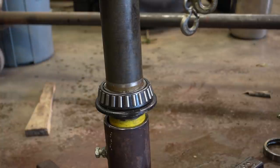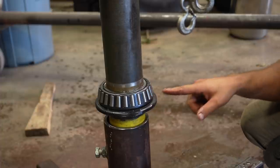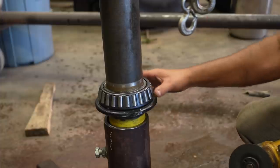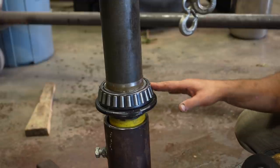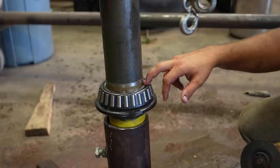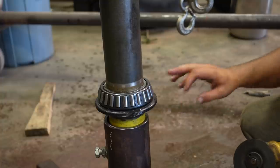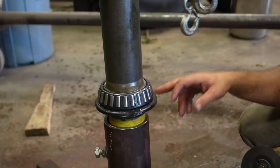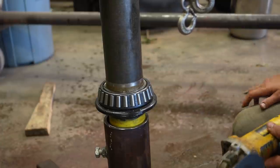Our last step for this job is to get everything off this axle. We've got a bearing here and the seal that rode in that cup we took out earlier. This bearing we're going to cut off and throw away because we're replacing all the parts. It's extremely important that you don't cut all the way through and get into your axle. I'm going to get the seal out of the way so I can see what I'm doing, then when I get to this bearing I'm going to leave probably a sixteenth of an inch where the bearing meets the axle and then hit it off with a cold chisel.